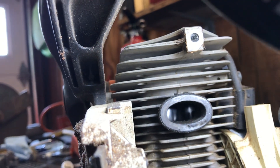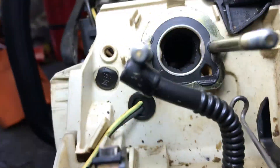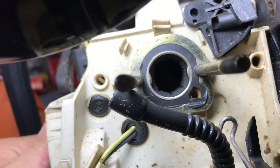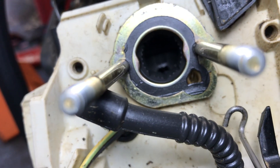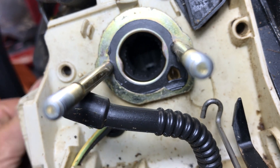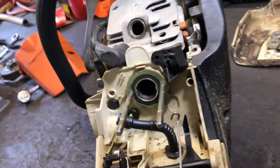There's actually more scoring on this side too, and that's typical of cold seizure — that's when you do not let a chainsaw warm up. When I got looking at it, there's a huge chunk taken right out of the piston on the intake side. You can see that hole — there's a chunk taken out of the piston and it scored up on the intake side even more. This thing is totally trashed. It does still have compression.